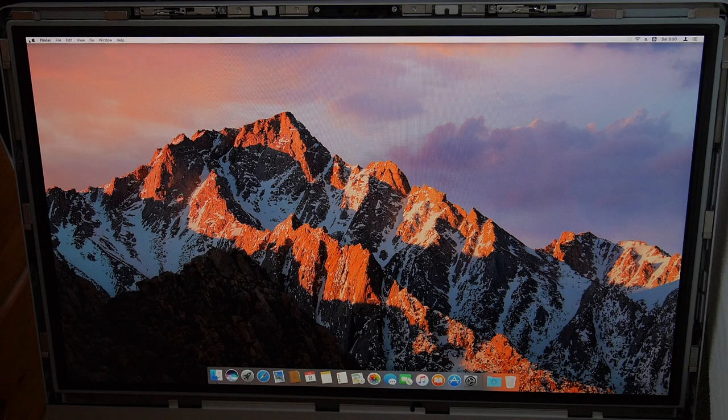But, you know, I'm confident that this second bake has done its job simply because the computer would not have booted to the desktop if the problem had remained. And you saw at the beginning of this video that it froze. Once you see this screen right here, it would freeze about at the halfway point, and then sometimes there would be horizontal lines on the screen. We're not seeing any of that now. It's going past the midway point, boots to the desktop.